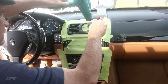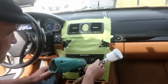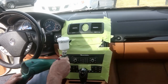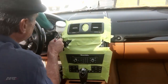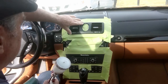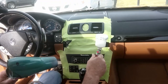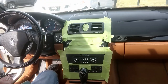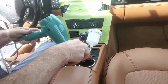As you notice, I'm using a minimum of masking here on these parts. The main reason is that the gun can be dialed down to a pencil point, so instead of having a wide fan with a lot of overspray, there is absolutely no overspray with the gun set this way. You can target each button specifically, and there are some areas where we won't have to mask at all, due to the fact that the sheen has been adjusted to match the surrounding panels.